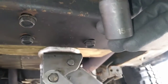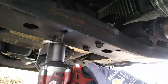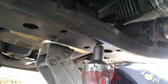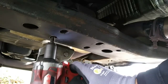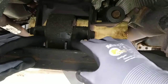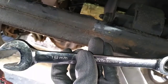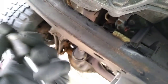You'll need a 15 millimeter socket to remove the four bolts from the crossmember. Then lift the transmission so you can get to the large bolt going through the middle. You'll need an 18 millimeter wrench to hold the nut still, and for the bolt head I'll be using an 18 millimeter swivel socket followed by a 12 inch extension.